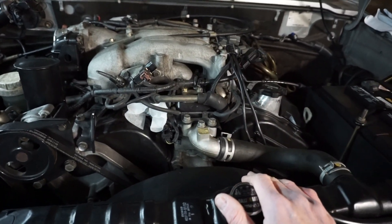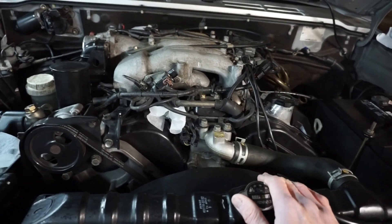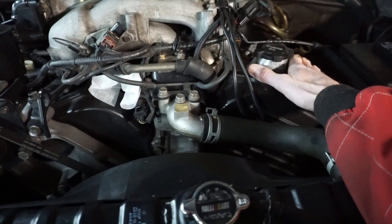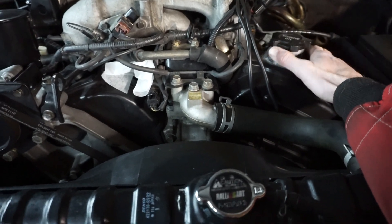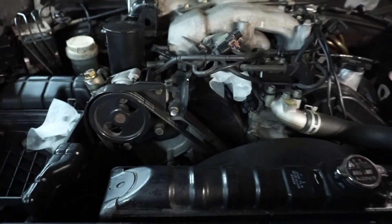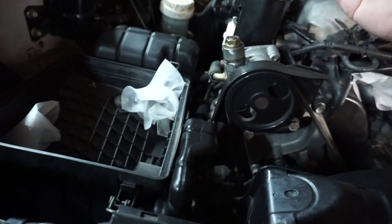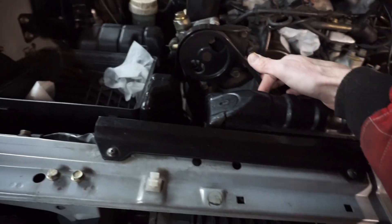This winter I had a little misfire. Initially I thought it was a damaged harness from mice, but thankfully it wasn't — that would have been pretty bad. It was just a bad coil pack. The truck actually only has three coil packs; it's wasted spark, with three wires running off those three coil packs to service the other three cylinders on the opposite side. Now it's got three new coil packs.